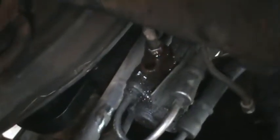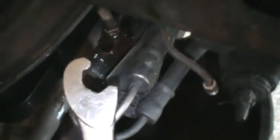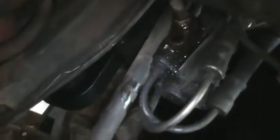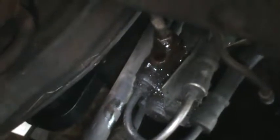Once I got the regular wrench on it, I turned it with much less force. The return line fitting is now giving me a problem because apparently somebody's been in here before and messed up the threads a little bit. 5/8" won't fit on it, and an 11/16" flare nut wrench slips. I have a special Craftsman wrench that's supposed to grip the sides of the socket, but the wheel is in the way, so I'm going to have to pull the wheel off.